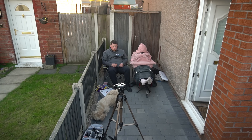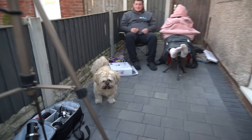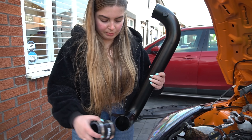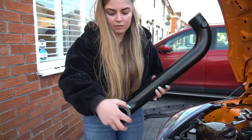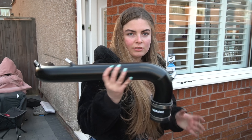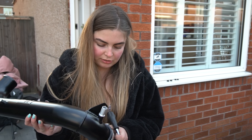Make me an offer — Max, say hi! So this is Max, my little doggy. Using the fat end of the silicone hose, put it on the bit where the crossover is going onto the turbo. Now that's on, I'm just going to use a 7mm on a screwdriver to tighten the jubilee up.